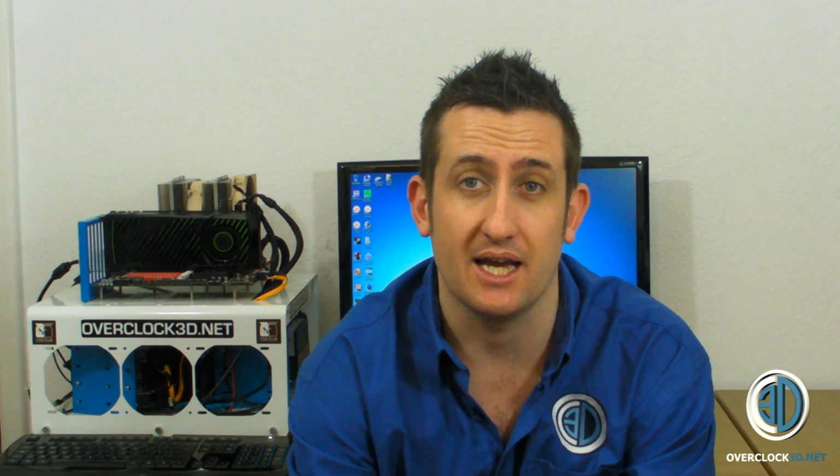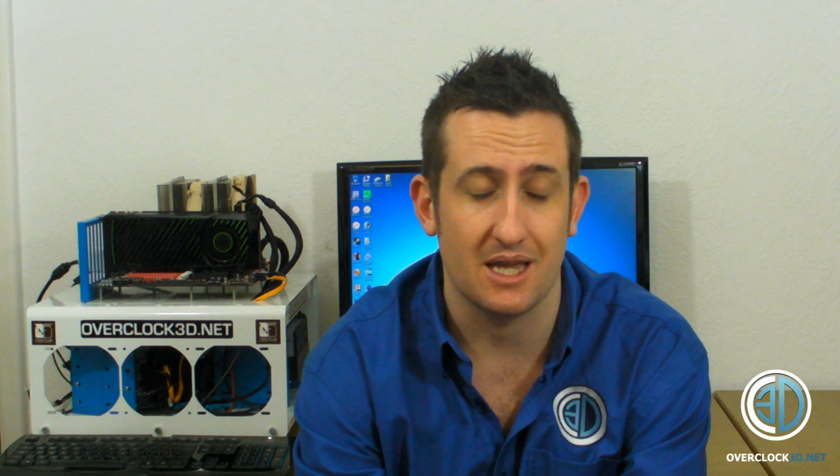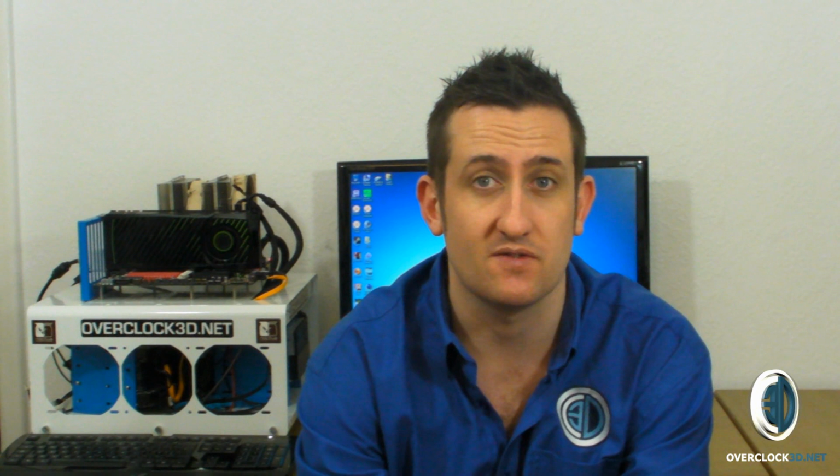For the minimal amount of work that you have to do for 4.6 GHz on the 2600K, and comparing that to what I would call a minimum overclock on a 950, which is 4 GHz, it absolutely blows it out of the water. The overclocking on this is very strange, but there isn't a massive amount that you really have to tweak to be able to get way past 4 GHz on these. So for beginners, it's absolutely amazing.